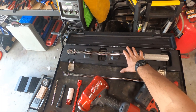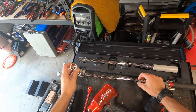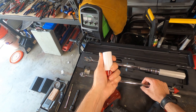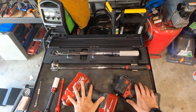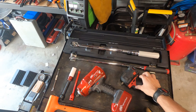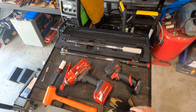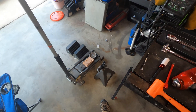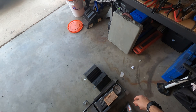Tools you'll need: a torque wrench and a breaker bar at a minimum. You'll also need the socket for your wheel lug nuts. If you're not going to be using a torque wrench, go ahead and use a torque stick. We also have some impact wrenches here — an Ingersoll Rand and a Milwaukee electric. It's also a good idea to have a mallet to knock the tire off if it's stuck on there. A set of gloves and eyewear is always appropriate, and of course jack stands, a jack, and some tire chocks.